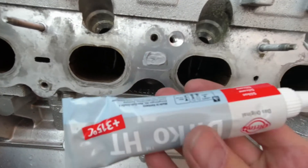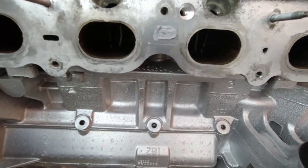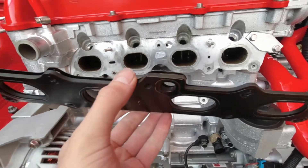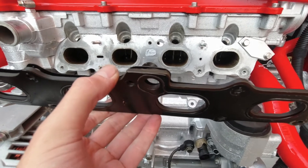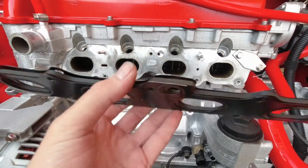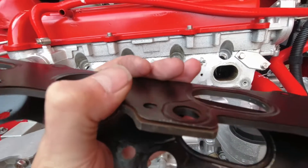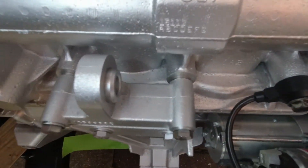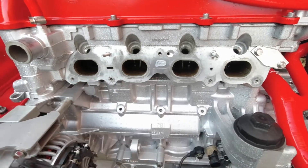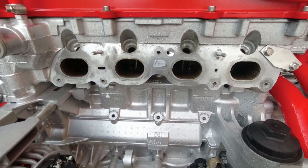The sealant is in place to cover the drilled hole — as the gasket goes on it should squash flat and create the seal. I'm actually reusing the old gaskets because the ones I got aren't metal, and these original ones are metal and look good all the way around the port. We've also got this thermal plate between the two that keeps heat from the engine away from the supercharger. The bracket is spaced off accordingly with washers to compensate for this sandwich plate, so the whole inlet sits off a little bit. Let's get this inlet manifold in place.